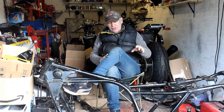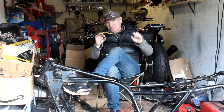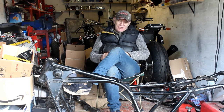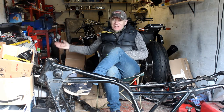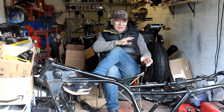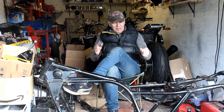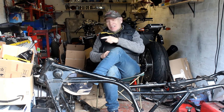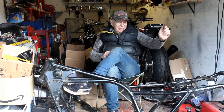Normally what I do is leave the frame powder coated and drop it over the engine on its side to build it back up. But for this one I might just carry on and build back up the running chassis so everything's ready, then plug the engine back into the upright frame - the engine isn't quite as heavy as a big Z1. Otherwise I'll have boxes around me for months wondering what to do. In the next month or two I'll concentrate on my part of the project - getting everything ready, finding any missing parts. I've noticed something is missing and I'll go find one. Also making brackets to fit the new rear lamp and making a new plate behind the side panel to take the M-Unit and perhaps a new rectifier regulator - the old ones are 40 years old, so I'd rather fit a new part for £70 and not worry about it.